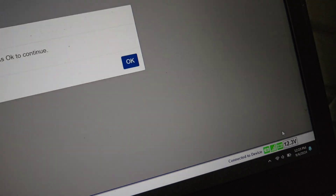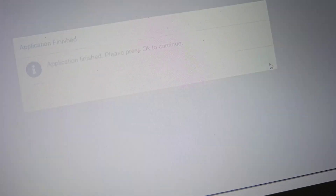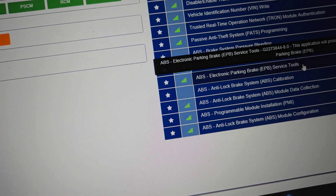If you're going to do it manually without the computer: hold the throttle to the floor, pull the EPB switch, and you'll hear it apply. Then step on the brake one time for one second. That is how you do the brakes with the brake pad sensor and how you put it in brake service mode on this 2022 Transit. You will have to step on the brake pedal when you take it out of brake service mode and hold it for one second.